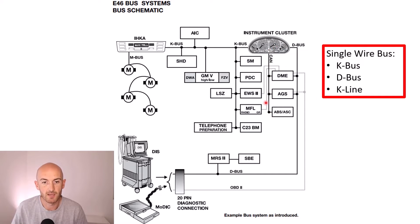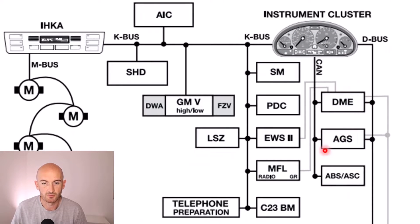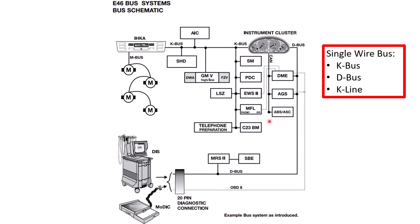However, we have got some CAN bus here — going to the powertrain network. We've got the engine control unit, the gearbox control unit, and the ABS module. That was where CAN bus really started for automotive. The first communications were between the engine and the gearbox so the gearbox could send torque requests to the engine management system during gear changes for a smooth gear change. ABS was then brought in to share wheel speed data and enable traction control.